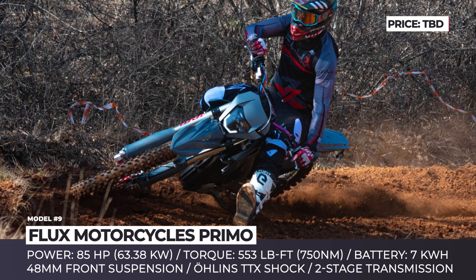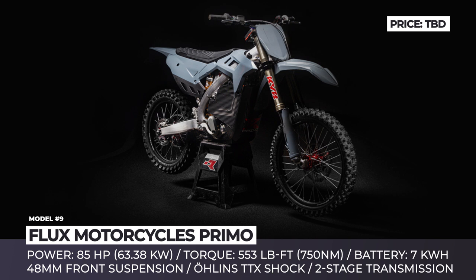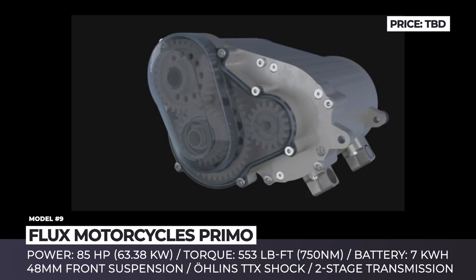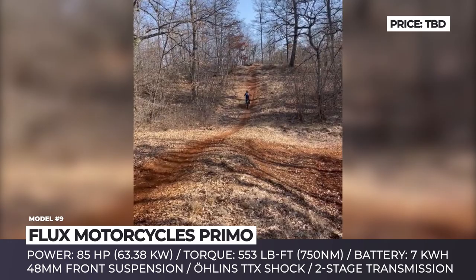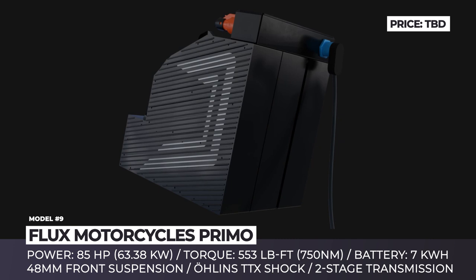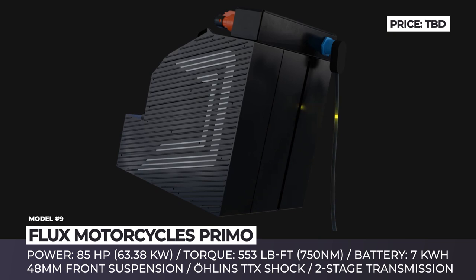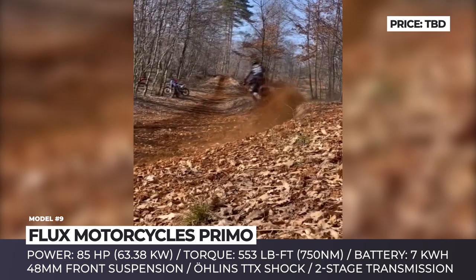Flux Motorcycles Primo. Like many other e-mobility manufacturers, Flux Motorcycles makes great emphasis on smart tech, innovative materials, and engineering solutions in order to create the next generation of motocross bikes. The list of most important innovations includes: a lightweight, high-rpm motor with water cooling and a single-speed two-stage transmission. Weighing just 17 pounds, this motor provides performance similar to 450cc bikes — 85 horsepower to be exact, 147 pound-feet of torque at the shaft, and 553 pound-feet at the wheel. There is also a water-cooled battery pack with hot-swapping capabilities that powers a 450-volt system, uses unique thermal control technology, and packs 7 kilowatt-hours of capacity while weighing just 75 pounds. A cutting-edge vehicle control unit offers six different parameters for actuating the motor's performance. Besides the power controls, the bike's app lets you track lap times, activate regenerative braking, and digitally lock the motorbike when it's not in use.